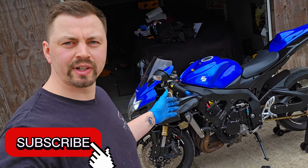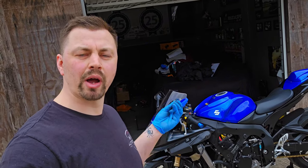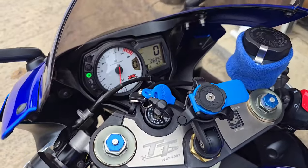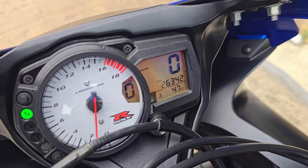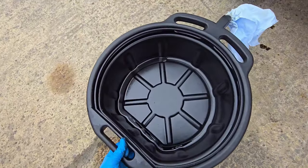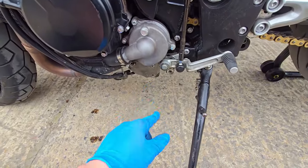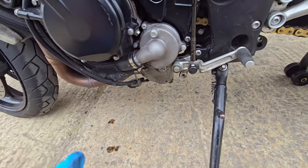The next step is to start draining the oil, but before we do that I need to start the bike up and let it get to a reasonable temperature so the oil gets hot and thin — that will help it drain out easily. I did actually ride my bike down to where I'm doing this and it's currently running at 47 degrees, so I won't need to run it too long. Grab something to drain the oil into — I've got this black oil pan. The sump bolt is located here and it's an 18mm socket you'll need.